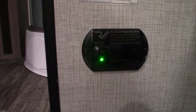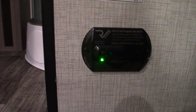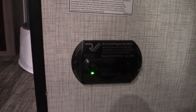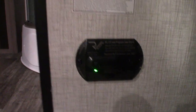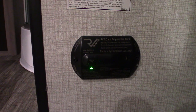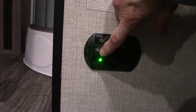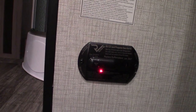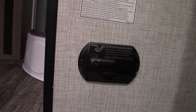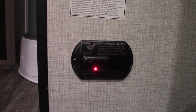This device here is your carbon monoxide and LP gas detector. It should always be green — if it's not, get it serviced. If it goes off, it has detected carbon monoxide buildup or LP gas, so you take everybody outside, leave the door open, shut the gas off at the front, and figure out what's going on. Also, if it beeps very slowly — the same tone but very slowly — it's telling you your battery is low. So it's a carbon monoxide detector, LP detector, and a low battery alarm. I'm going to put it through the test cycle just so you can hear it. LP is good, carbon monoxide — good. And then the low battery alarm. And then back to green — it should always be green; if not, get it serviced.